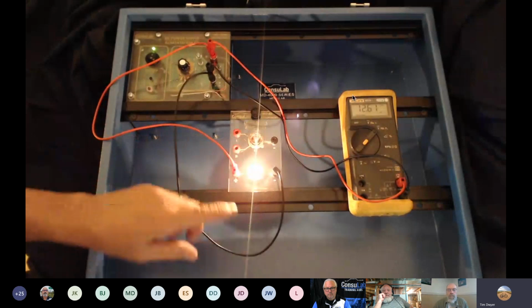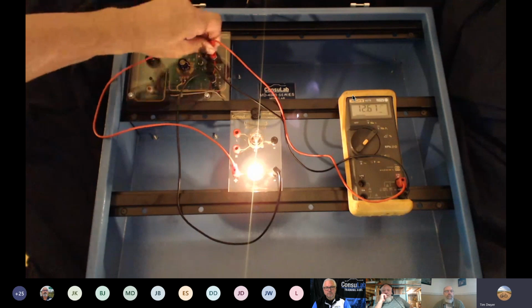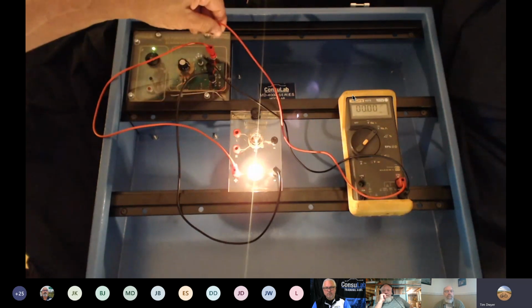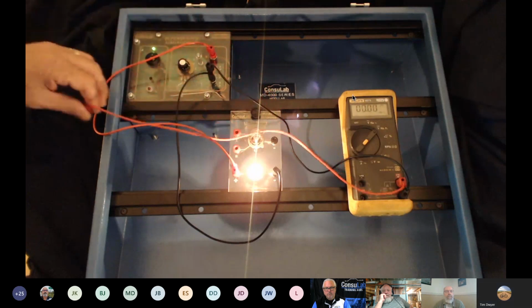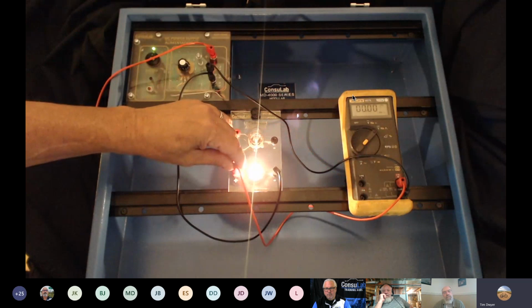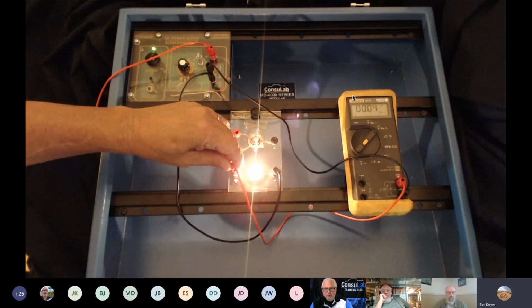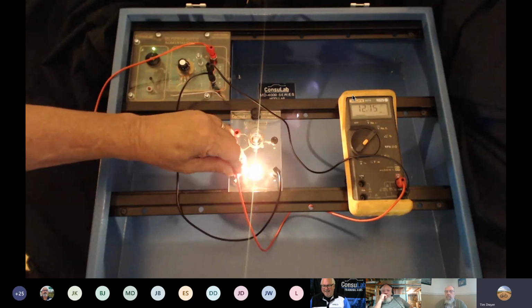We see that there's work being done. We said it could be in light, heat, motion, magnetism. Well, this is in light. And as I left the battery, I'm going to measure it again, I'm at 12.6. I made my way down the circuit to right before the load, and what's the expectation? Hopefully 12 volts. 12.6. Better say 12.6, don't go.